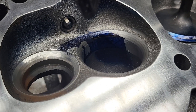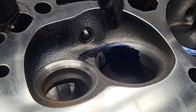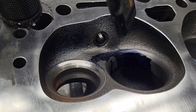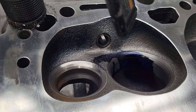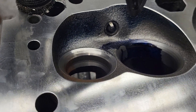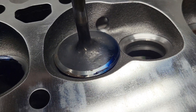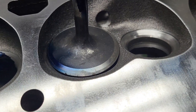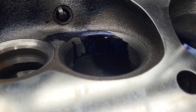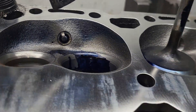I've got something going on — it may just be that the head gasket I was using is toast. So what I'll probably do is reflow this exact port and exhaust and see how far off it was. In any case, I wanted to do a preliminary on this. I'm going to say we're going to take about five CFM off the numbers you guys are going to see, but the airspeeds will be right.